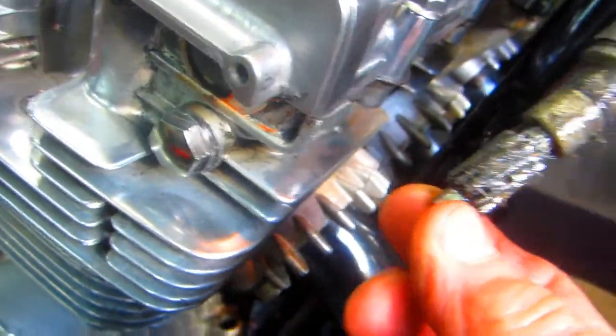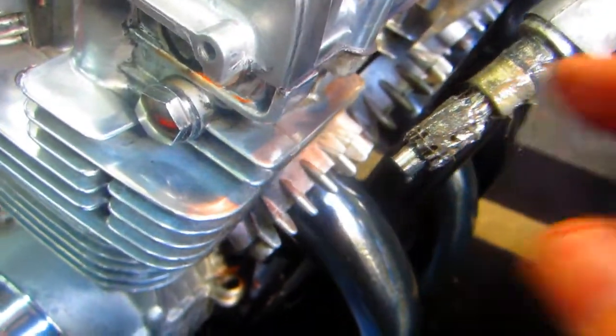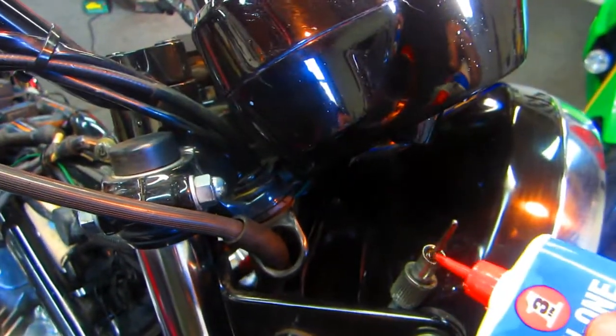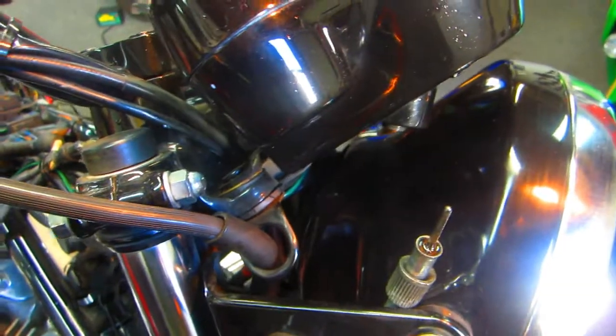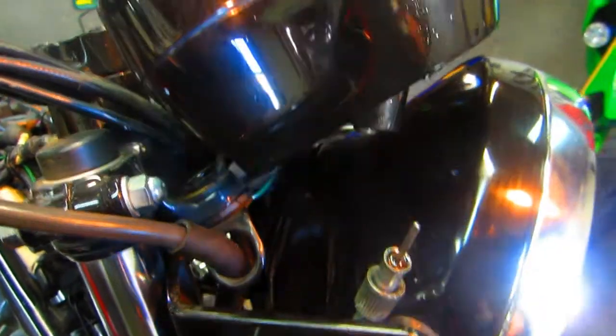Now before I assemble this back, I took the speedometer cable, pulled it out, put grease on it. This is very easy to do at this point. Grease the gear, and that'll be ready to reinstall. And anytime I have the speedometer cable off, of course, a couple of drops of oil. And now what'll happen is, just take a minute or so, as I twist that, that'll go back down right down the cable.